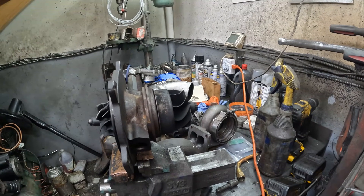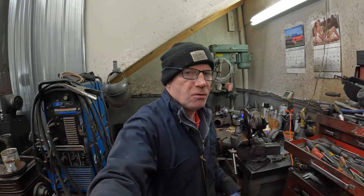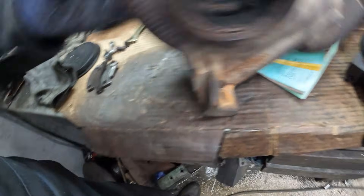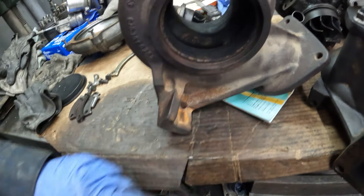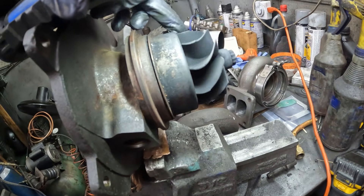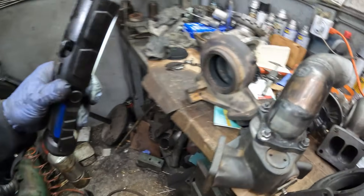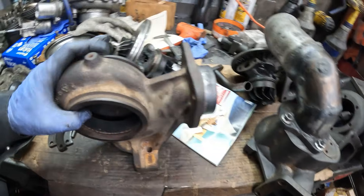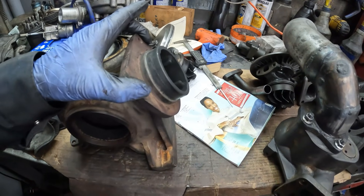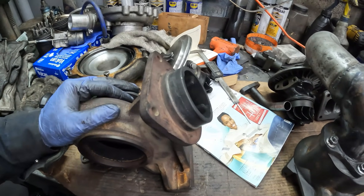So I'm limited right now to 65. Without spending a whole bunch of money on turbos and then figuring out they don't even work, I can do this in the shop and figure it out myself. Here's the housing for the big turbo — it's an open turbo as well, open housing and fairly shallow on the inducer here. It should be interesting to see if I can light this one. What I'm going to do now is clean this housing up and weld on a T4 flange and mount it up on the Detroit. We'll try this one after a couple more turbos.